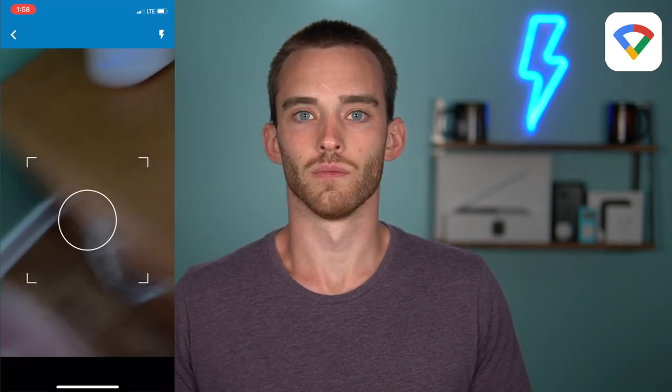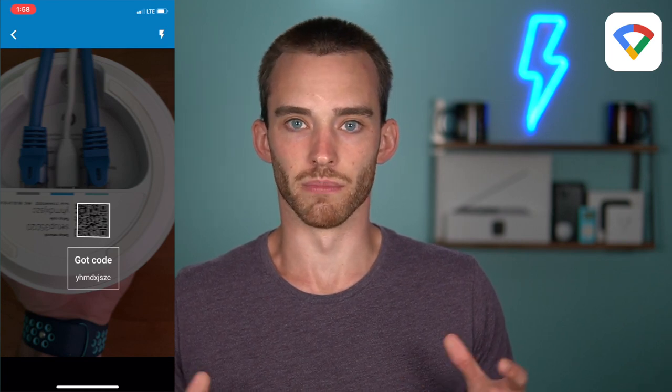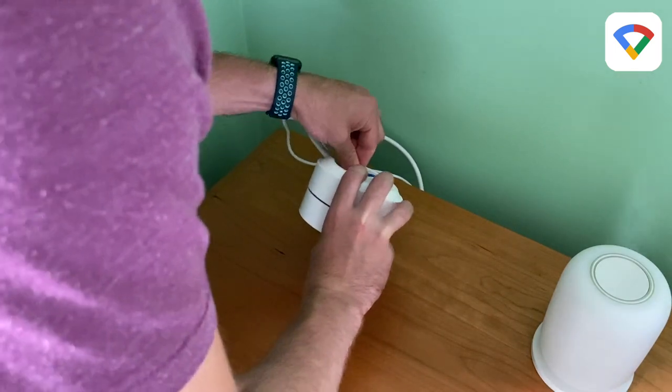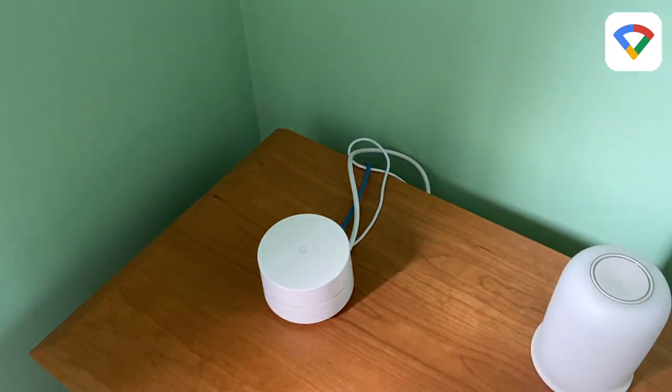To save yourself some time, unplug the modem from the outlet, then plug the modem into the router with the ethernet cord, and then plug both back into power. Once they're powered on, scan the QR code on the back of the Google Wi-Fi, which will connect you to the dummy network, then open the Google Wi-Fi app and configure from there. I've installed Google Wi-Fi seven different times and ran into issues in half of them, but in my latest install I got the system up and running in 15 minutes.